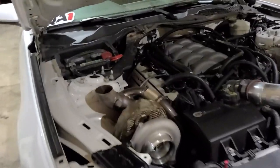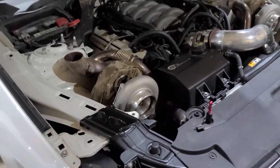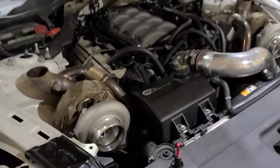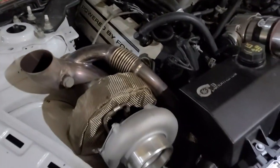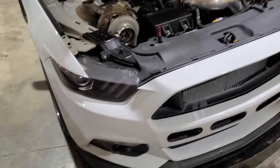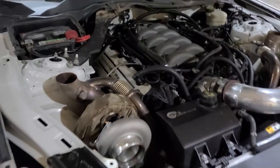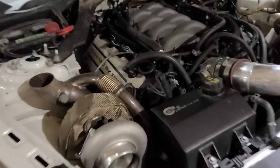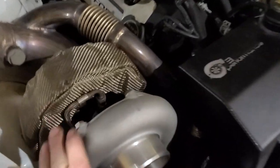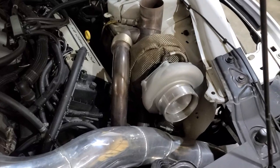A little about the car — I bought it about four years ago completely stock. It made 700-800 horsepower for a full year, then I decided to change the turbo setup. It used to have a low mount; I switched to a top mount kit with 61s on it. With the 61s I was running around 920 wheel at about 150 in the quarter mile, around a 6.0 at 121 in the eighth mile. I was having issues with back pressure — really small exhaust housing on them. The new ones are a 1.02 exhaust housing, they're a 267, and I haven't made any passes with this setup yet.